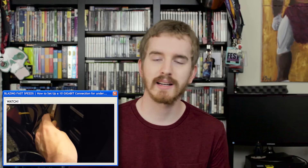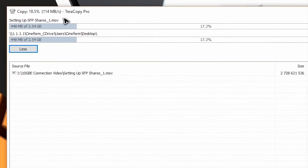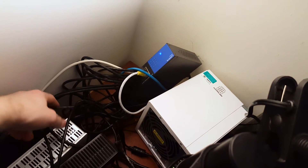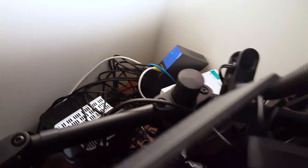For a while — I even made a video back in like January — I was using a 10 gigabit ethernet connection with an SFP Plus connector and a couple Mellanox 10 gigabit ethernet cards. I've since stopped using that because, as many people pointed out from the speed test in my test video, I wasn't getting the full proper speeds to even saturate a regular gigabit connection. So I've optimized my switch a little more — now everything's running through a big 18-port gigabit switch, which includes a couple of NAS drives, a brand new NAS server that I just got for review, my rig, Ryo's rig, and a bunch of other stuff. The speeds are quite nice nowadays.